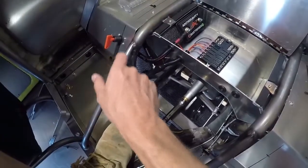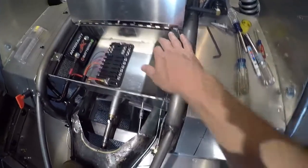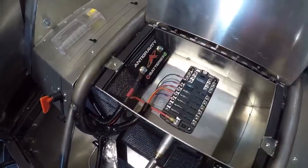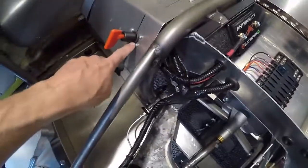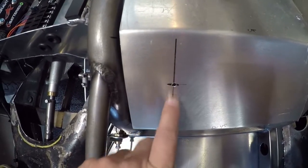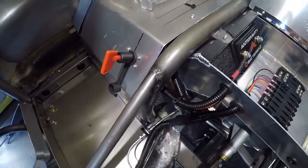When I have the second battery set over here, I'll have another disconnect switch mounted right over here, so I'll be able to decide if I want that one on — close that switch — or this one on — close this switch. I'm not going to install this battery or switch until I'm really towards the end of the build because these are $200 each. But I did mark this out and gave myself a pilot hole, so when it comes time to install that one I can easily just drill the hole and it'll be in the same general location.